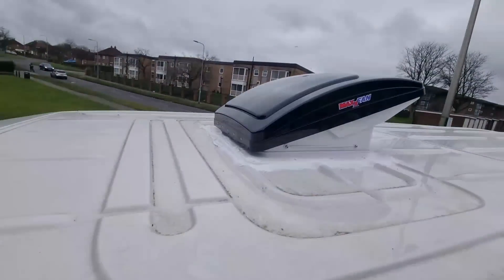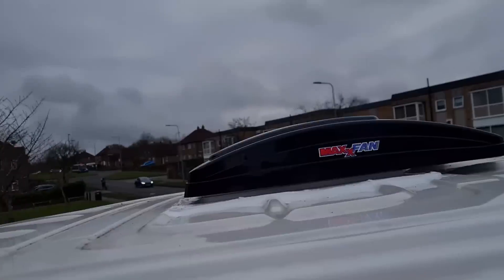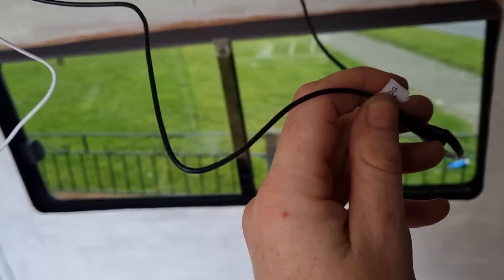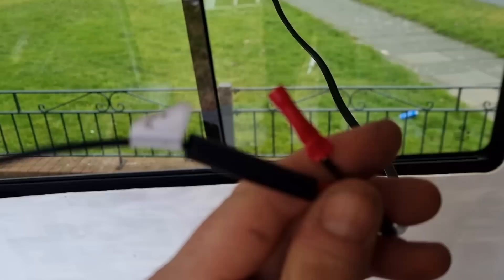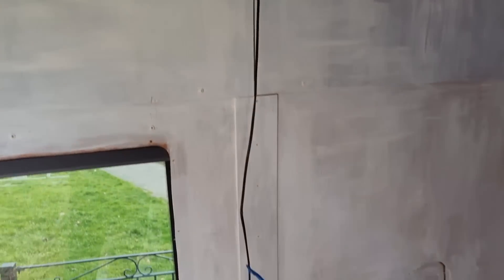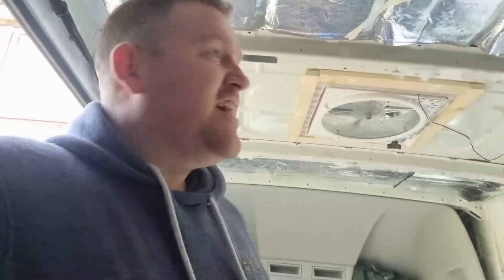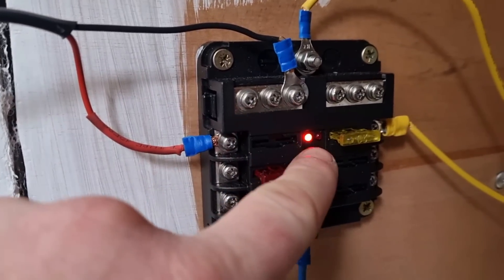We done another thing! Let's just hope it doesn't rain while it's drying. To manually close the vent, just keep twisting - you can see it slowly coming down on the inside. When wiring it up, be careful: the black wire is NOT negative, the black wire is positive, and the white wire is negative. Run them together, crimp the joint, heat shrink over the top, and run it over to the fuse box.